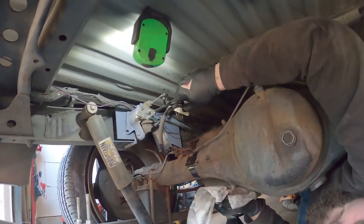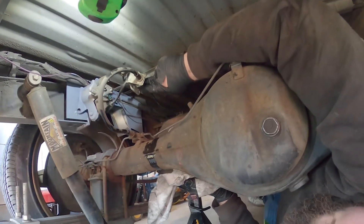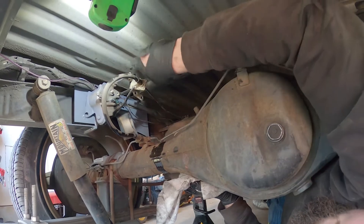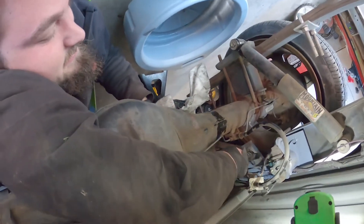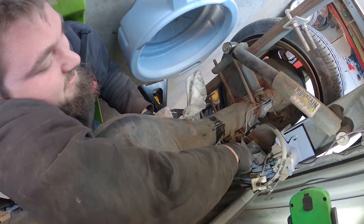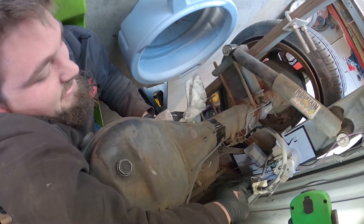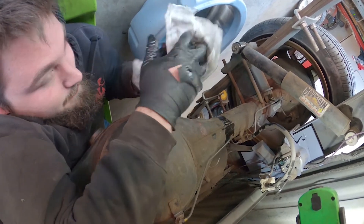Basically this hard line that's now attached to the soft line fed the load sensor. The load sensor fed the rear brake line, and this line returns brake fluid to the front, which we blocked off and removed the line up at the front. So the goal is to remove this line, remove this load sensor, and just have one straight line back from the master cylinder.